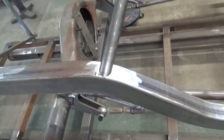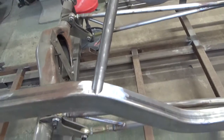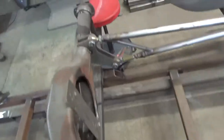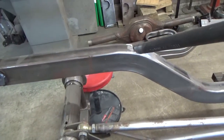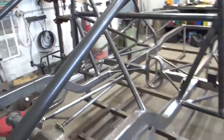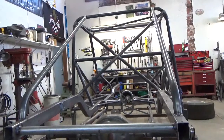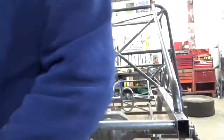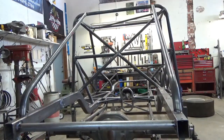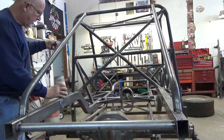You determine a distance where you want the tubes to hit. I wanted them to hit on that flat right there on the frame rail, so I measured back from the main hoop support, the same on both sides, and got a reference mark with a square so I knew where that tube would hit. They're laying in about the same location. First thing I do is take two magnets and a piece of string and pull the string from where I want it to hit on the top to where I want it to hit on the bottom.